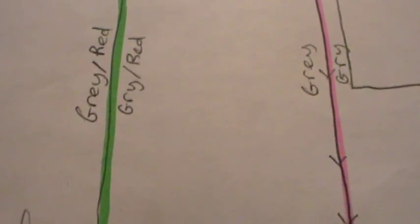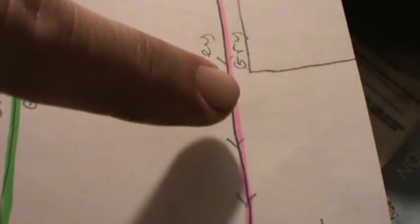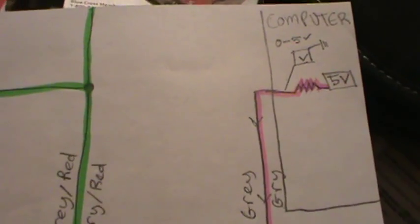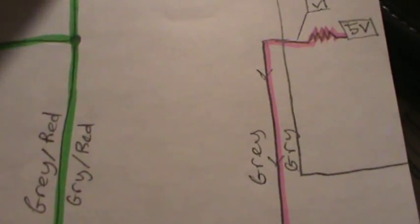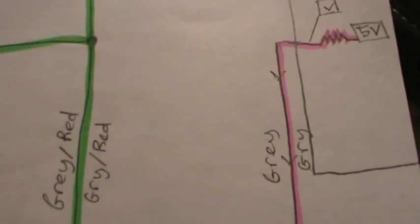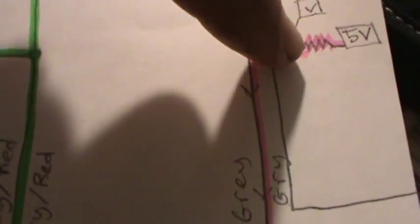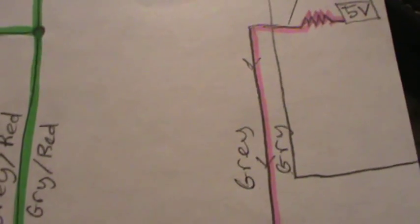But if you notice inside of this, this is a resistor. If this thing got shorted on the inside — let's say these wires are touching, or this gets shorted to ground right here, this wire rubs through and gets on a hot exhaust manifold and rubs through — it is not going to damage this right here. It's not going to damage the five-volt reference because you have the resistance. What's going to happen is it'll drop to zero volts here, but this resistor is going to protect it from damaging itself.